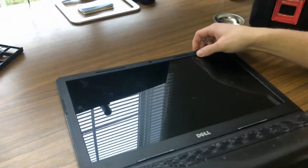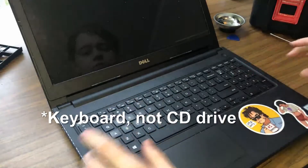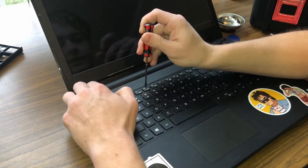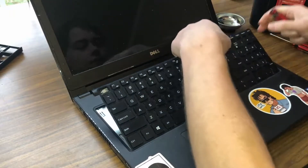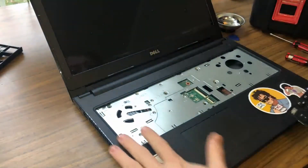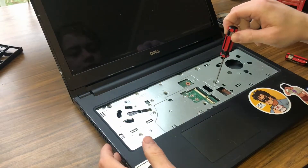We're going to open it and see how things are on this side. This one is going to be a little bit trickier — we'll have to take the CD drive out because there are probably two or three screws underneath that we need to access. I normally use a smaller flathead for this. Stick it in these little locks in the front of the keyboard. Not all laptops have these — some keyboards are underneath and sink through the chassis of the laptop. We'll clean the keyboard nicely too. We can see there's one screw right here.